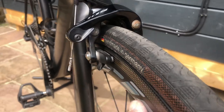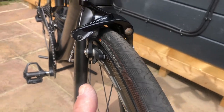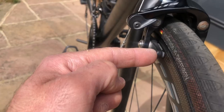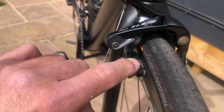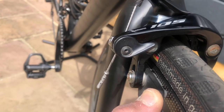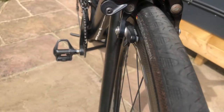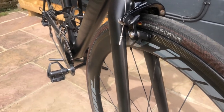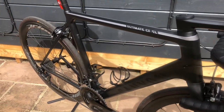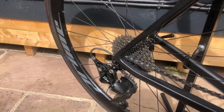The brake track after almost two years and 10,000 kilometers (7,000 miles) is still in very good condition. I've changed the brake pads a couple of times. One important thing to consider is the toe-in — don't do it too much, otherwise you'll wear just the front of the pad. Just a slight toe so when the caliper hits first it cleans any debris, then the full force of the brake is applied, ensuring smooth and silent braking. In wet conditions it will also displace the initial layer of water.